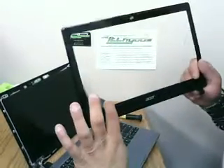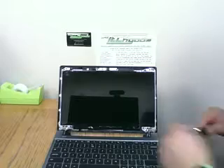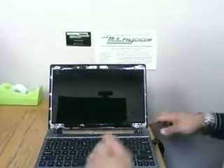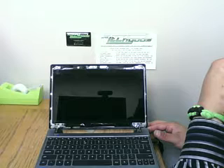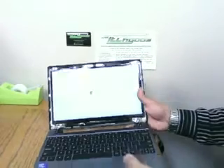At this point we'd be tempted to put the bezel back on. However, having done this more than once, I'll note that sometimes it doesn't go as planned. You want to make sure that it works before putting the bezel back on. So we can go ahead and plug it in without the battery attached and turn it on — let's see if it comes up. We have backlight, and then we have the Chrome welcome screen coming up. So it appears that everything is back to normal.